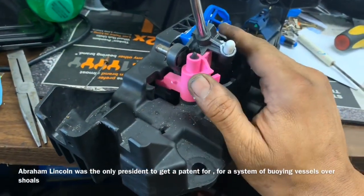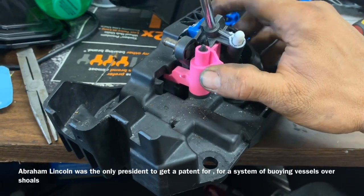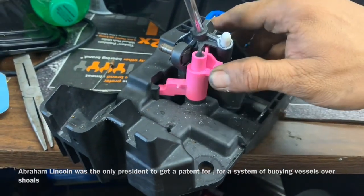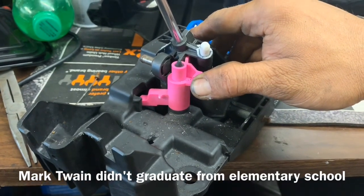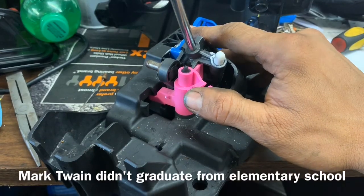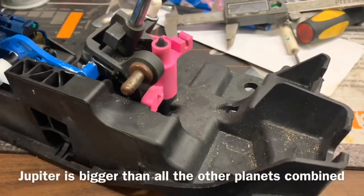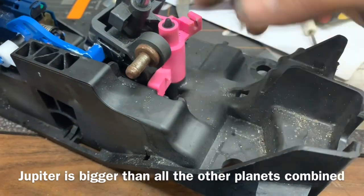It really doesn't surprise me that that spring broke, because that takes a lot of force to be able to push this thing all the way over. And this has got to hold like this the whole time that it's together. So that little teeny tiny post right there isn't going to do much good. We're going to get a spring that's about 2 inches to 2 1/4 inches, so it's able to stretch and move properly.